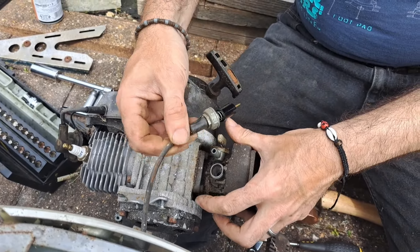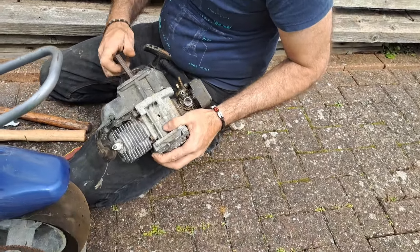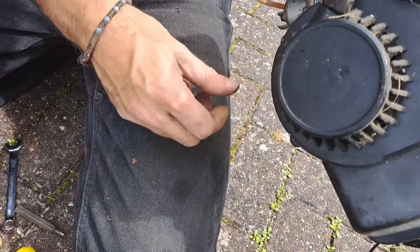The drain tube is alright. We need a smaller Allen key. Are we going to take the engine apart? Not fully apart. Should we check to make sure there's no water in the engine? No, it's good — there's no water in there. Just got to get this cover off so we can get to the electrical. Do these have fuses? No. They've got a coil behind there and they've got a pickup. It's a flywheel magneto — it produces its own electricity. It's a spark. Oh yeah, of course — that's why you pull it. Yeah, it's got no spark. So we'll just get the cover off and figure out why. See what's in there.